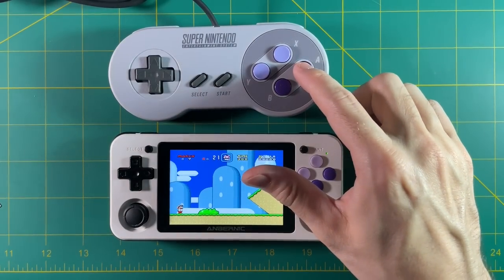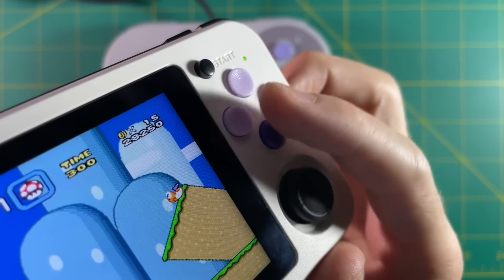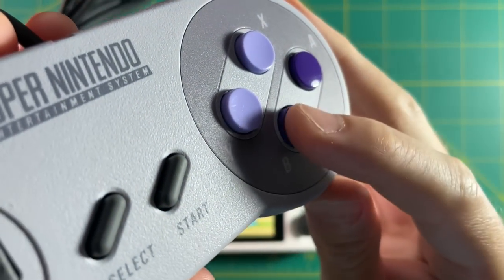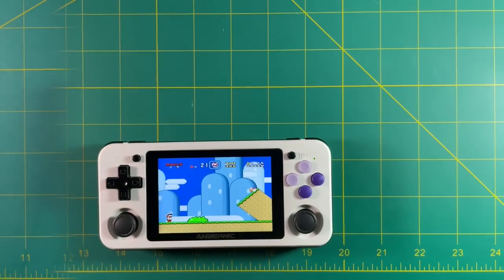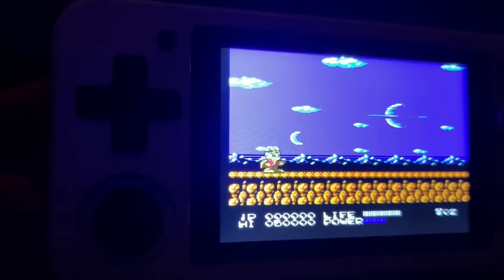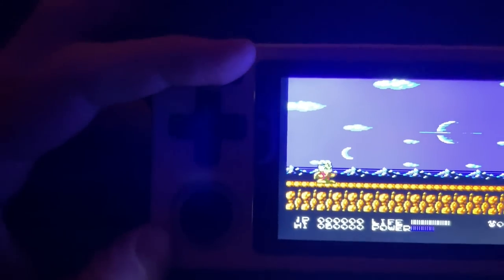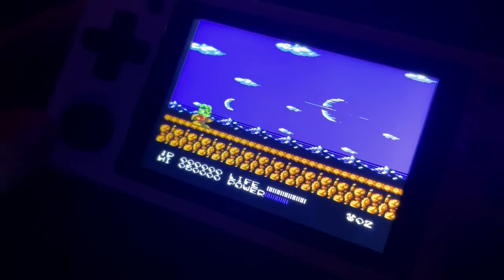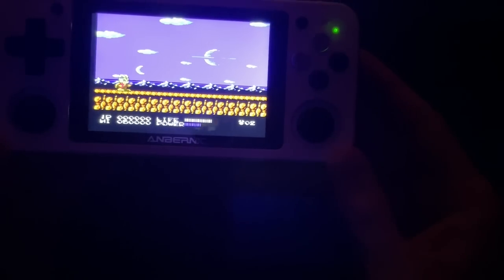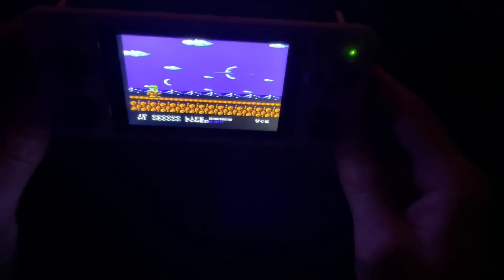I really love the tiny little pop of color that's now on my device. These buttons are 3D printed, and one of the things that's different from the original SNES controller is that they have a matte look and feel — they have a little bit of grippiness, and I really like that. The original Super Nintendo controller buttons are very glossy and shiny; personally I like the matte buttons better. Now let's test out my light bleeding mod. As you can see on the left, there's still a tiny bit of light bleeding on the upper part and bottom of the screen — unfortunate, but it's still miles better than it used to be. The LED light is really bright and you can see it coming out of the shoulder buttons, so maybe I'll open it up again and put a little tape over that LED to dampen it. But overall I'm happy — I fixed a lot of the light bleeding with just two pieces of electrical tape.